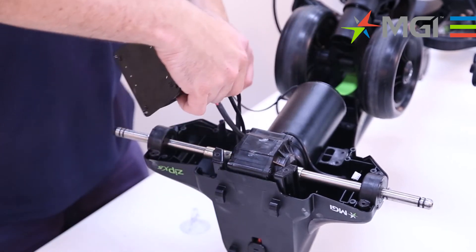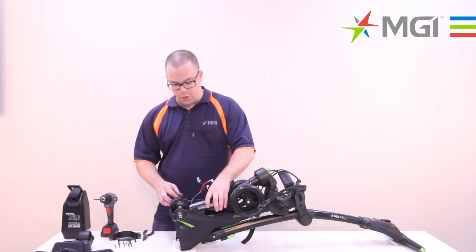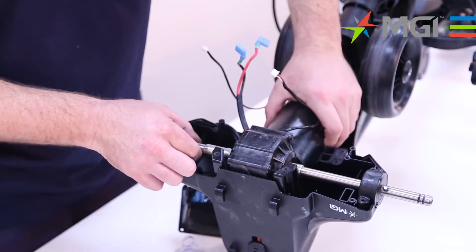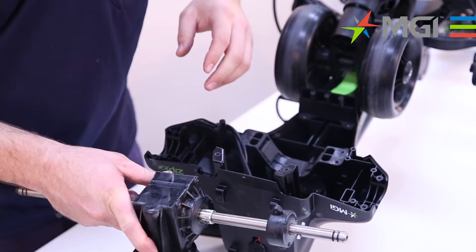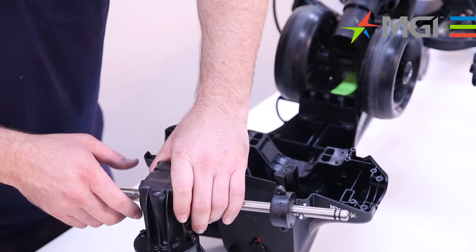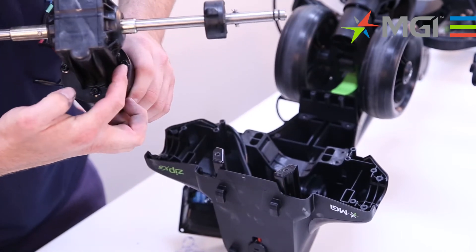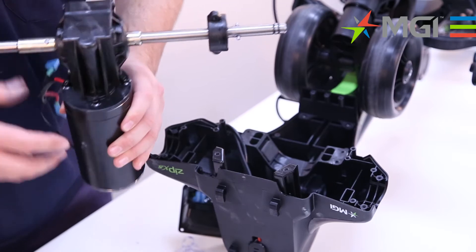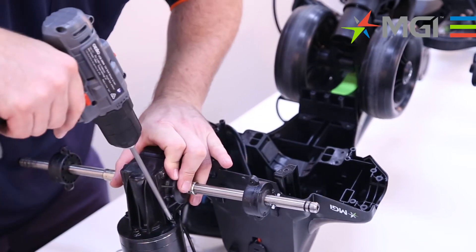You can now put the motor controller to the side. Now that the four screws have been removed from the bearings, you can take the gearbox and motor out of the housing. You will now be able to access three more screws — one, two, and three. These three screws connect the gearbox to the motor. So I'll proceed with removing these three screws.